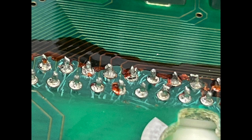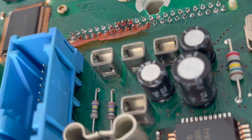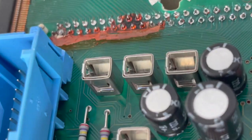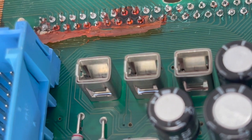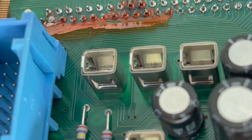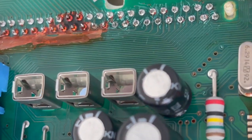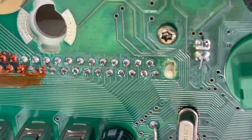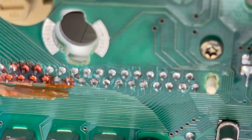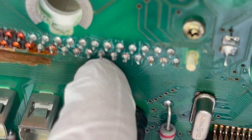Here it is — it was, in fact, pin number 7. Number 6 is also not that good, either, to the left of it. You could see, finally, I was able to peel this off. The job with the razor, trying to make sure that I don't damage the tracks underneath. At least I got this mostly peeled off. And then I'm going to do the soldering job. One of them is really badly corroded, or at least cold-soldered — you could see it right here.